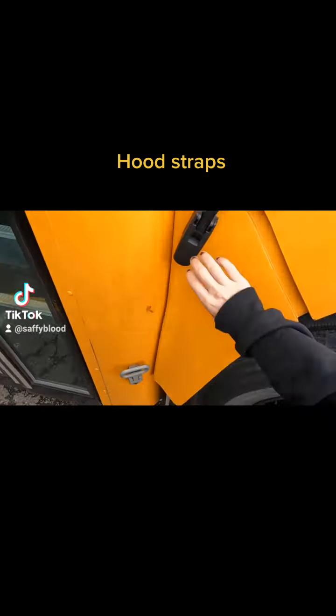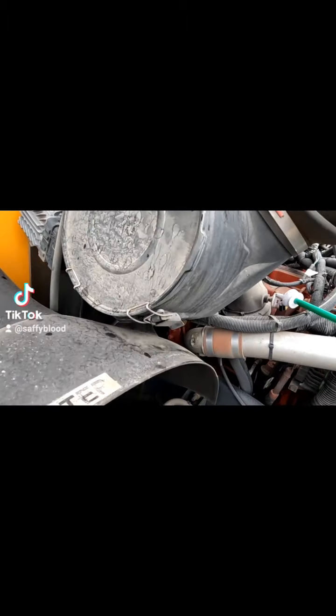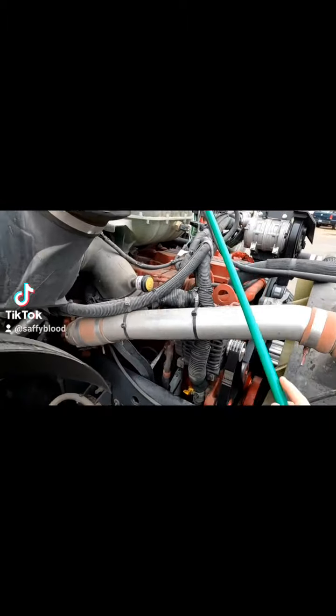Going under the hood, we start by checking our air intake canister, making sure it is securely mounted with all bolts present and tight, latches secure, no damage like cracks, and we check the indicator to make sure the filter is clean. Then we check our coolant reservoir and washer fluid reservoir, making sure they're both securely mounted, no cracks or leaks, caps present and tight, and both full of fluid.